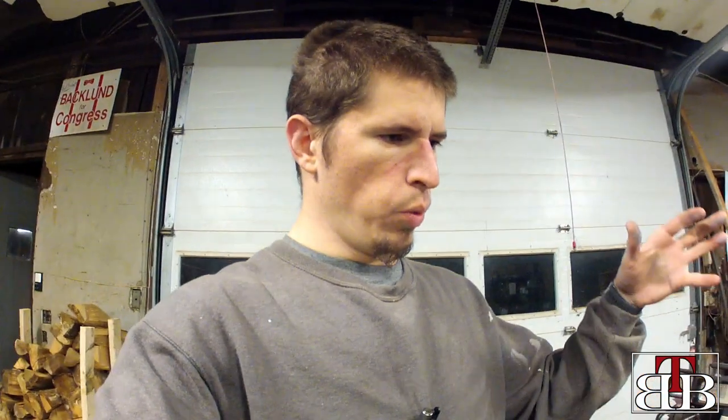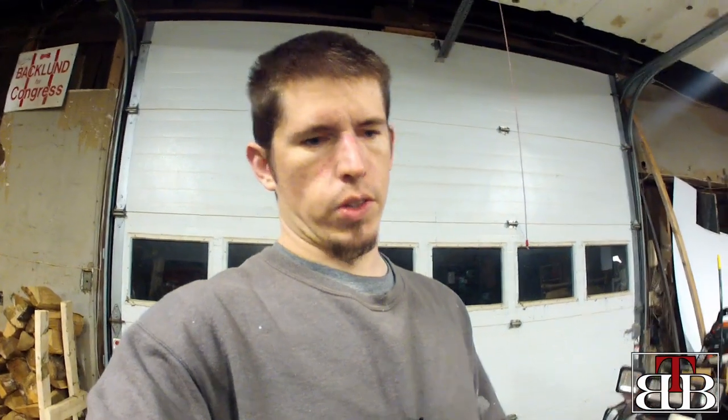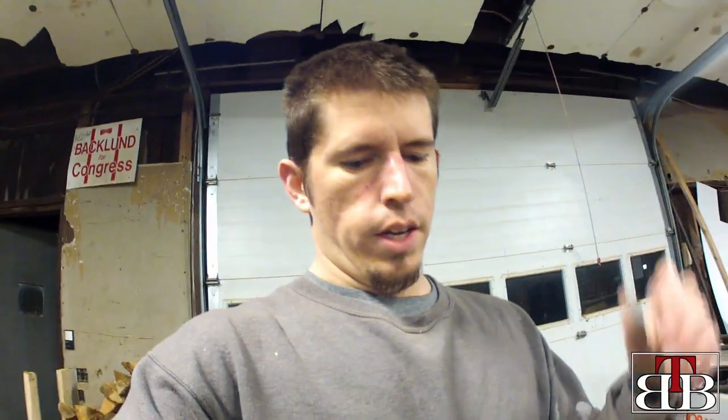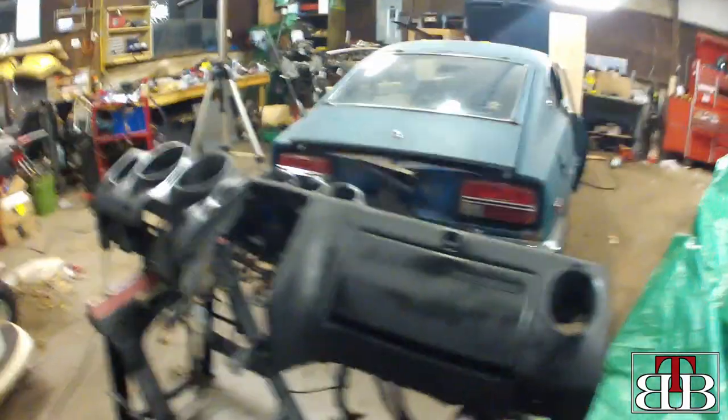But success. I'm going to walk you through where I am right now. We've got some dry time before we can actually flock this thing, so bear with me. As you saw in the time-lapse, after I had all the Bondo down and sanded — I went 80 down to 200 grit, finishing with 220 — after the 200 grit everything felt super smooth, looked really smooth. Of course the second you put primer on something, everything starts to pop. So here's what we have now — a few steps ahead, primed, ready to be touched up, sanded again, a little bit — dash prior to flocking.